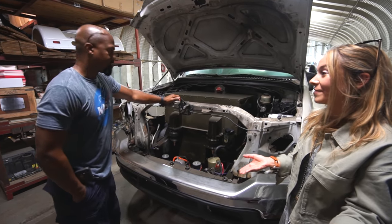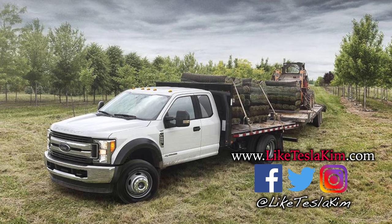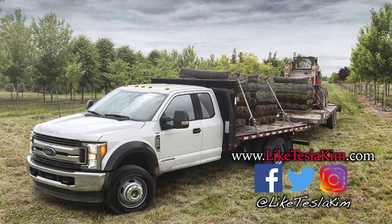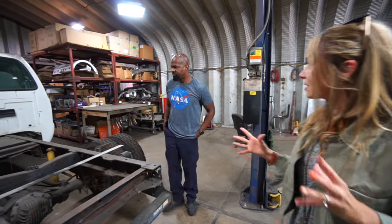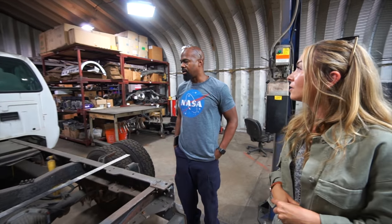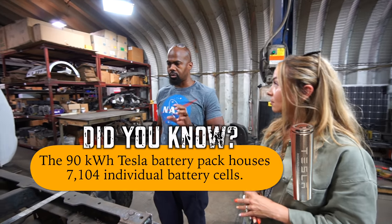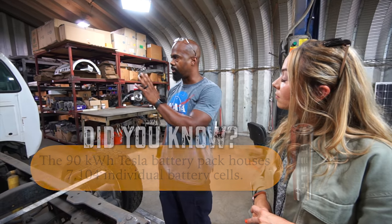It's not just the F450. Right now we're going to go take a look at it. This is a Ford F450 Dually and it has a Tesla inside it — a Tesla Model S. We're going to run a 90 kilowatt battery. We're going to run an EV controls controller which basically overrides the Tesla immobilizer so that you can operate the truck normally.